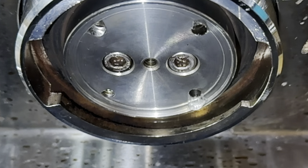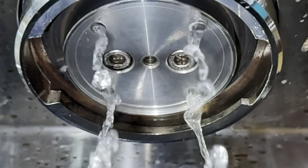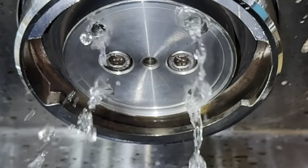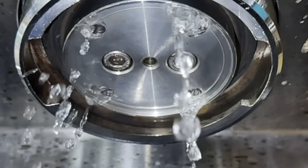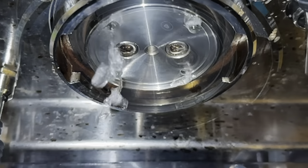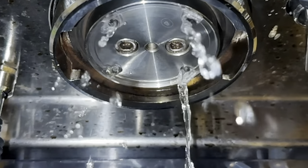This is what the Decent does as well. The challenge is that at higher temperature and higher pressure, water will come out of the two holes on the right first, meaning more water is coming out on one side. I did some measurements to show this unevenness of water flow.